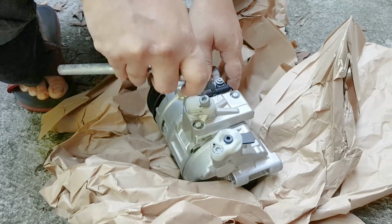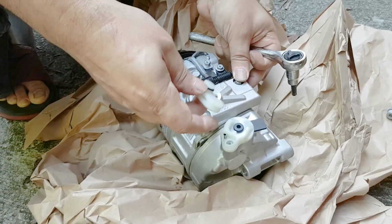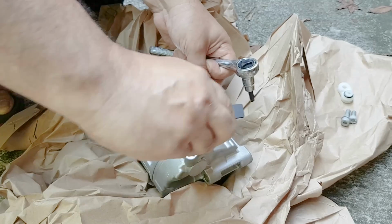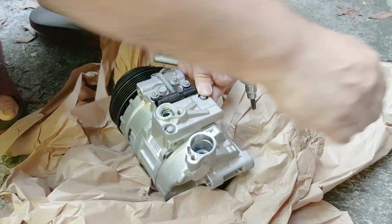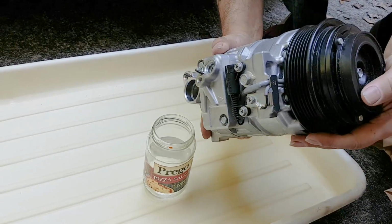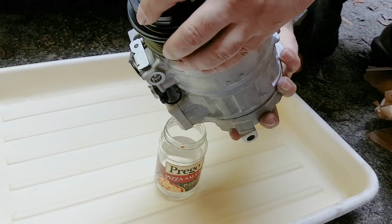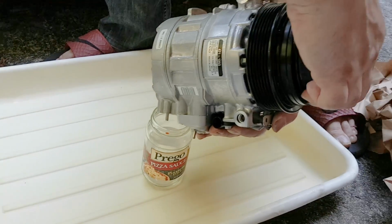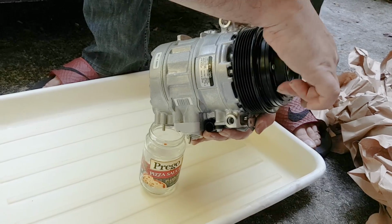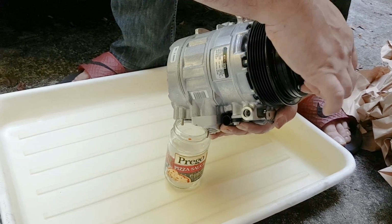The new compressor comes with, some of them come pre-filled with compressor oil, some don't. Regardless, you want to empty the compressor from any pre-filled oil, and you do that by taking a jar or some vessel and weighing it first to see what the weight of the vessel is, or the glass bottle in this case, and then turn the clutch as you empty the oil. This is PAG 46 oil, or at least you want to fill it back up with new PAG 46 oil. I'll have that in the description.